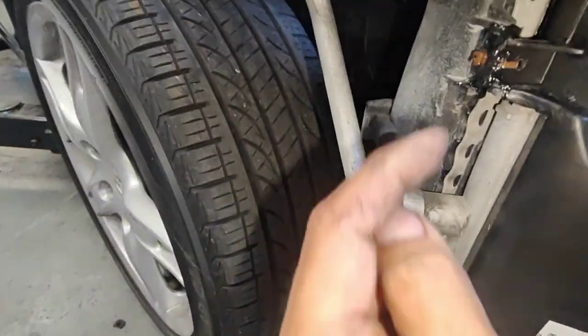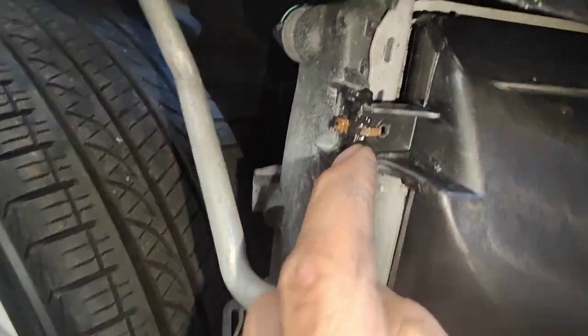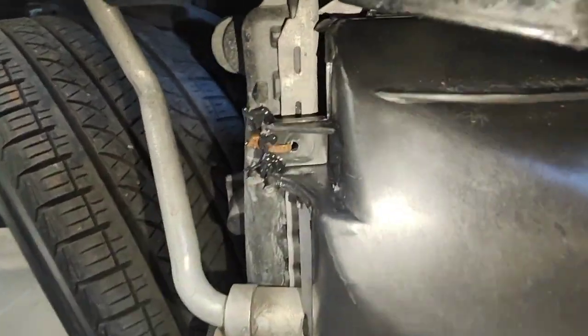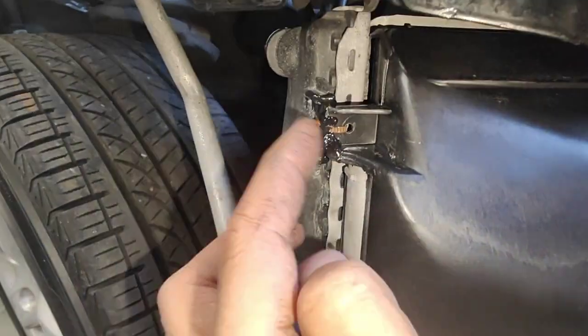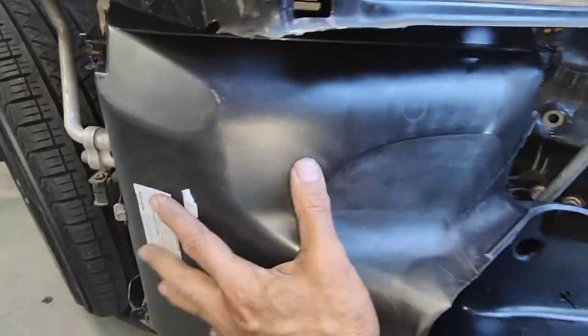As you can see, we had to drill a small hole on the housing on the radiator and put some glue on it to hold it in place, so you can see it's nice and tight here as well. The reason why we drill and use plastic glue and a cable tie is because the radiator housing has been broken off already. That's where this part here is bolted onto.